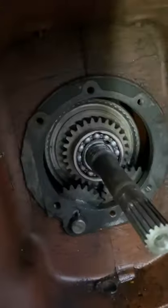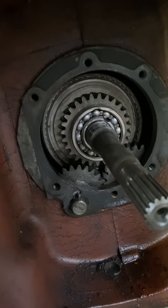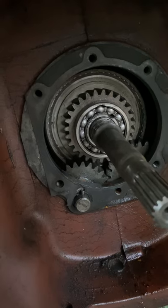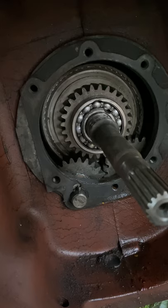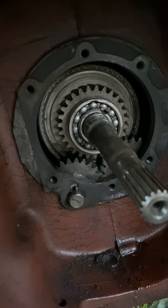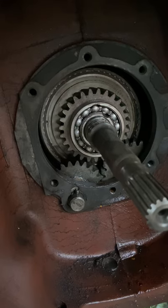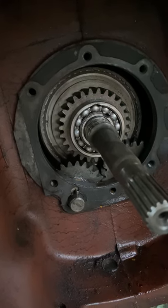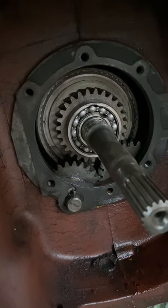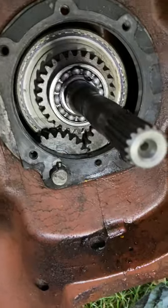It's not very hard putting that main shaft back in. Realistically it'd be better if you had some help to guide it. Just remember to put your shims on the back of it — you've got shims on the back there on the bearing. Generally I believe there are three, so just put the ones back in that came off, as long as they're not damaged.